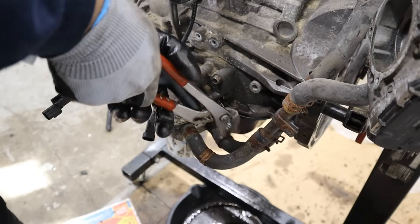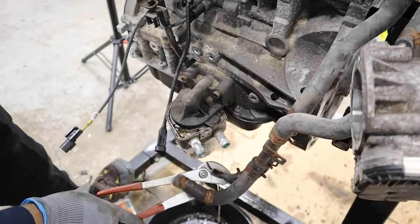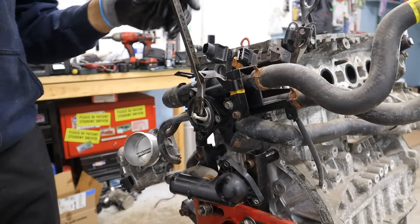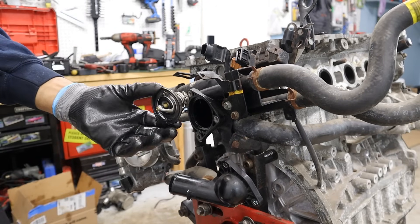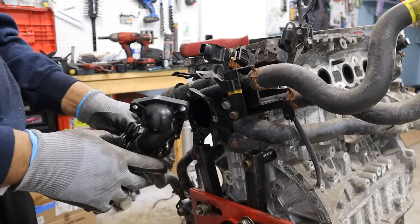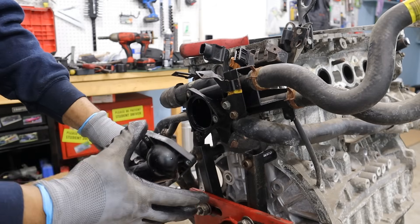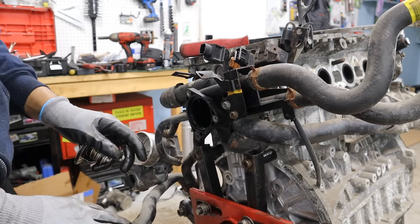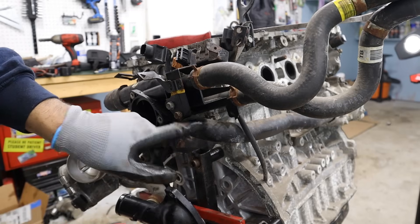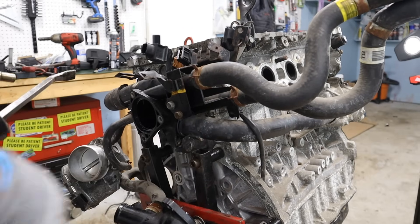I've been avoiding the cooling system because there's a lot of coolant in there that's going to make a mess. The oil cooler is the lowest point, so we'll start by taking off these hoses. Let's get the thermostat off. Out of here we have a traditional style thermostat with a nice metal frame — at least it's replaceable and not one piece. I don't like the use of plastic in the cooling system because coolant gets very hot, and over time the plastic will expand and contract, eventually crack, and cause a leak. This entire coolant manifold is actually made of plastic, which is even worse.